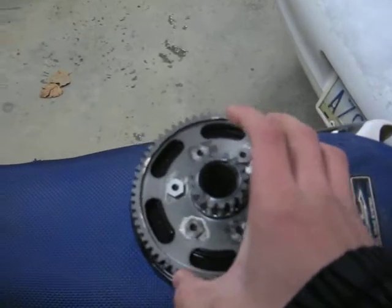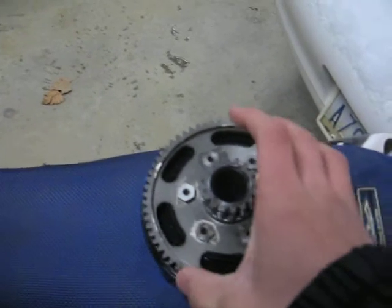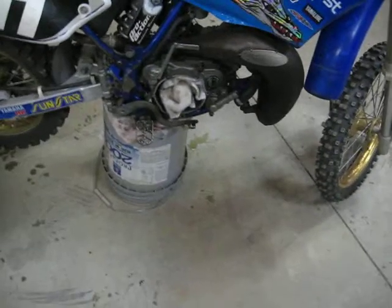This is the clutch basket that I gotta replace. I'll show you real quick - move the top primary gear and see how it's got that play in it. It's not supposed to have any play in it. That's what's making that smacking sound when it shuts off, so I gotta replace the clutch basket. It's got tons of play. It has newer brakes, new top end, newer crank, and it's going to get a whole new clutch. Other than that, plus grips and front tire, the engine's going to be pretty much brand new.